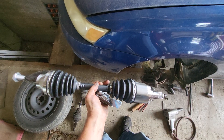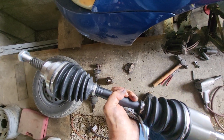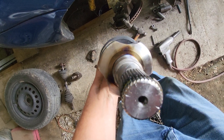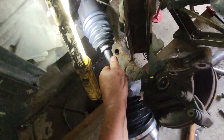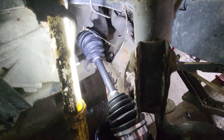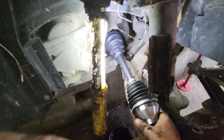We'll get the new shaft. When you're handling these, don't hold it in the up-and-down position by one of the joints because it could pull apart — always hold it by the shaft. I found the gap and the circlip, so I'm going to put that down where the gap is pointed down. Slide it up in there — some people say put a seal in it, that's okay, but I'm not going to. Get it to the point where you can't push it in any further, then just use the shaft to push it in. It went in.